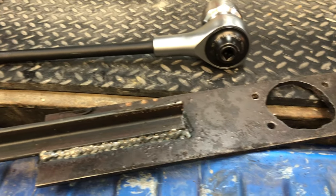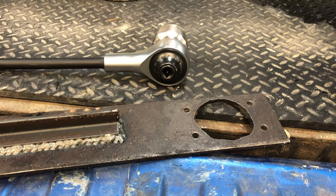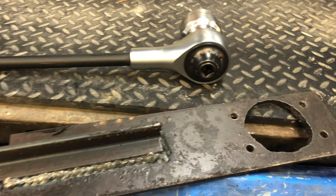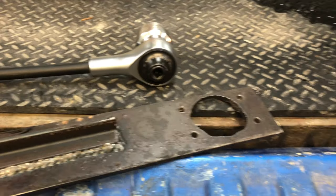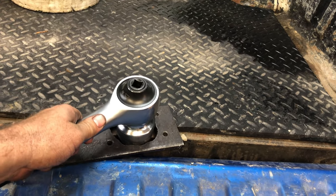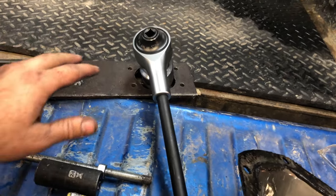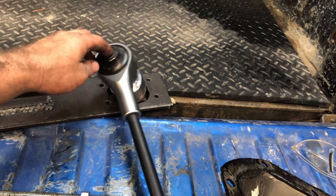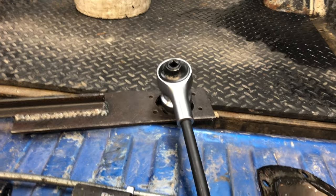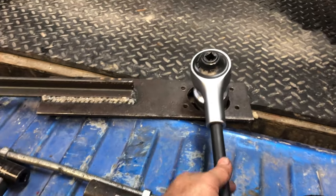This is a tool that I made. Those four bolts line up to the bolts on the yoke — I would put that onto the yoke and have the end of this angle iron touching the ground. Then you put the torque multiplier with the socket on the pinion nut, and this also touches the ground to keep everything solid. From there you put a flex bar in and go ahead and loosen it off. The same operation works for tightening when you're ready to torque it together. This setup worked great — absolutely no complaints.